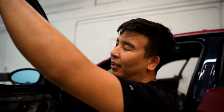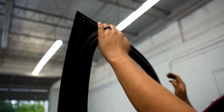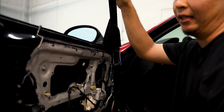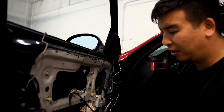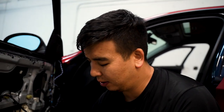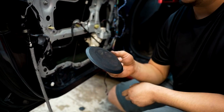That's the proper way to install it. Make sure the plastic piece goes over the door frame and then goes behind the gasket so you don't get water inside. Now we'll move on to the front door, which I'll use a different door panel — and we'll use a different cover because this cover is just not it, not at all.